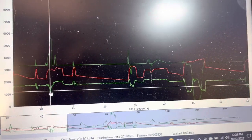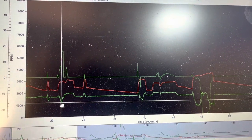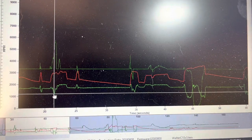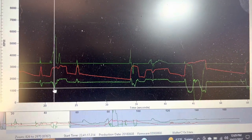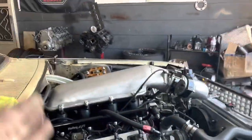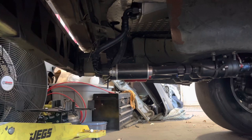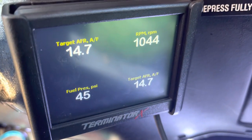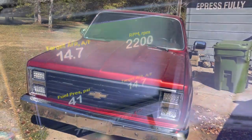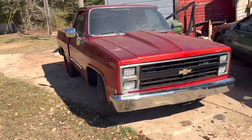I can't tune it this way because the injectors are not going to flow consistently. I need the injectors to flow the same across the board no matter what. You need to maintain the 58 PSI that the regulator is supposed to show — injectors are generally rated at a given PSI at 43, and Holley will adjust for pressure, but you need consistent pressure. Consistent pressure. That's the problem. I didn't put this truck together, I didn't commit this sin, and I can't make it go away unless I get paid. As you can see in the data log, there's fuel pressure all over the place — if you drive normally it'll do fine, but as soon as you walk the throttle open it dives, and sometimes it recovers, then falls back off. Until he decides he wants to pay more money, I'm done.